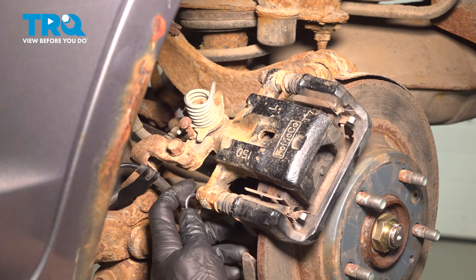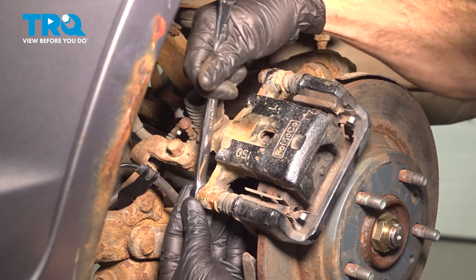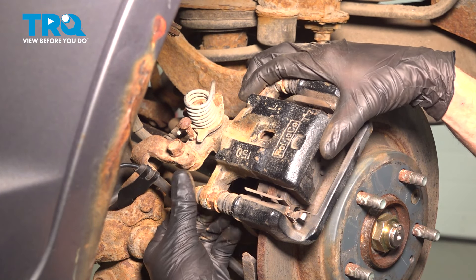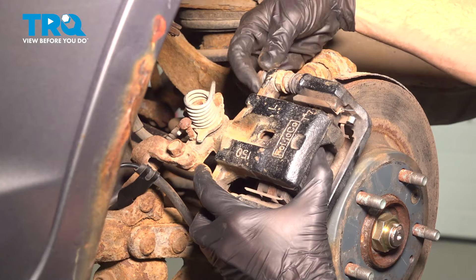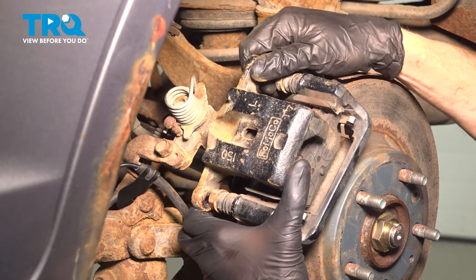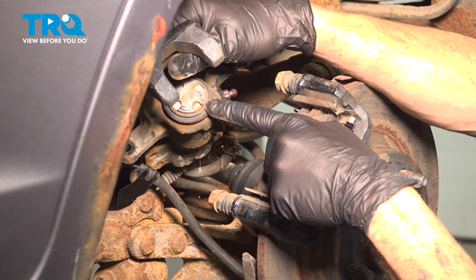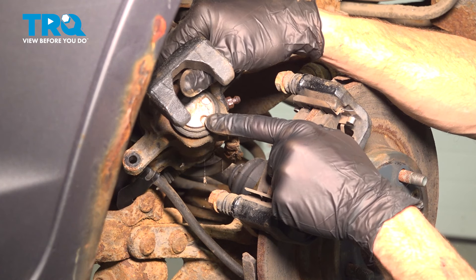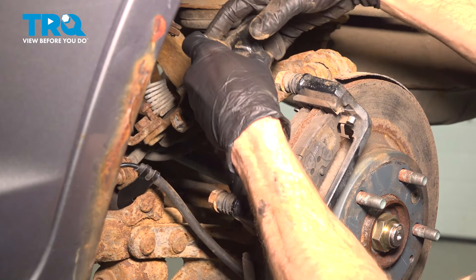Give it a quick inspection. Take hold of the caliper, give it a little wiggle and slide it off of the brake pads. Once you have the caliper out of place, the next thing that you need to do is pay attention to where the caliper piston is located. You're going to find that you have a small dust boot that makes its way all the way around. If you happen to see any fluid making its way out of here, the caliper is no good and you need to replace it. Assuming it looks good, set the caliper aside putting no pressure on your flex hose.